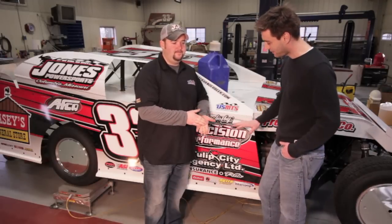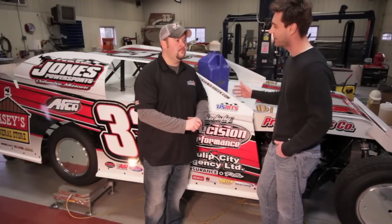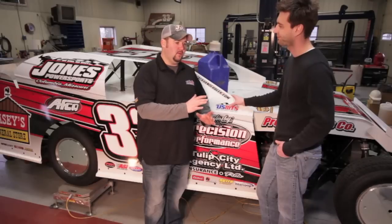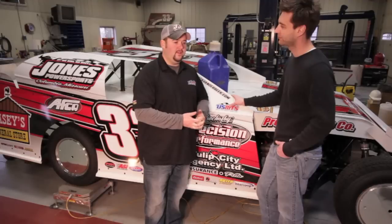Let's say we've got our ride heights adjusted right where we want them but a number isn't quite right — what might that be? After your ride heights are correct, you can manipulate the numbers where you want if you do the proper turns around the car. The next step in the way I scale would be left side percentage and rear percentage, getting those close. That's controlled by moving weight around — we have lead weights we put on the car in different positions to achieve the percentages we want. Another way to add weight is fuel — that can be a tuning tool as well.